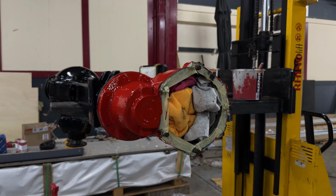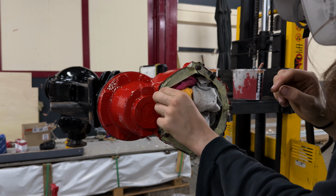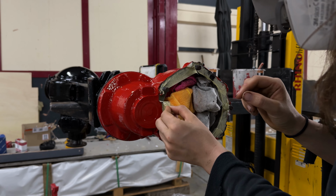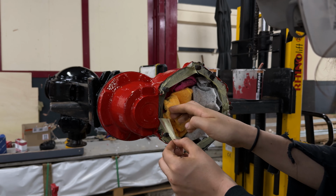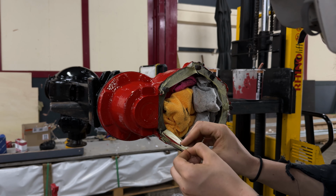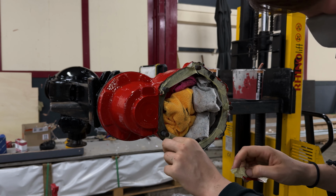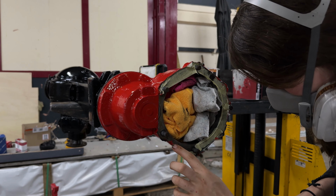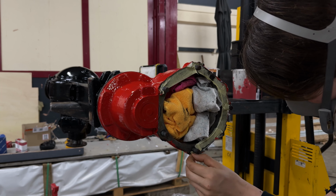I painted the part where the hub connects to the axle red. The reason I painted this red is so that leaks are easier to spot, and I also think it just looks really cool. My truck has a Volvo B30 red block engine, so I wanted the color to match the engine. I used the color Ford Red from POR15, which is a direct match to the Volvo red block red. I spent a couple hours researching this, reading different forums, as it was really difficult to find a color that would match my red block.